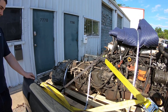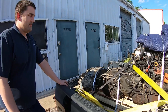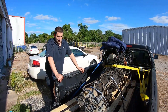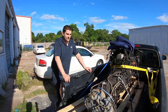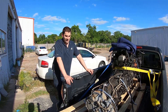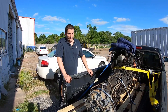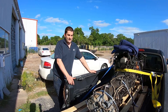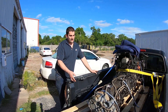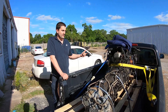It's pretty much going to be spare parts. Jack, you want to talk about what the plan is for all this? Yeah, the plan is basically — I can't even get it out of the truck at this point, so I'm gonna have to take the transmission and the transfer case off on the pallet, then we can slowly lift each piece off, separate the transfer case and the transmission, and get the engine up on the engine stand.